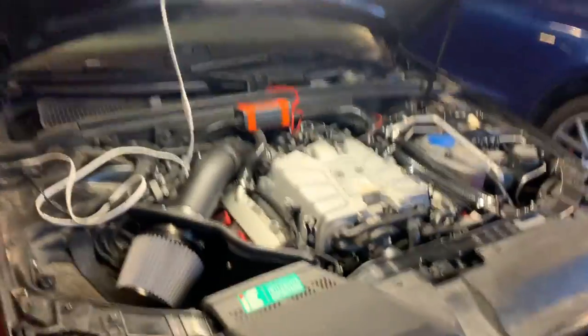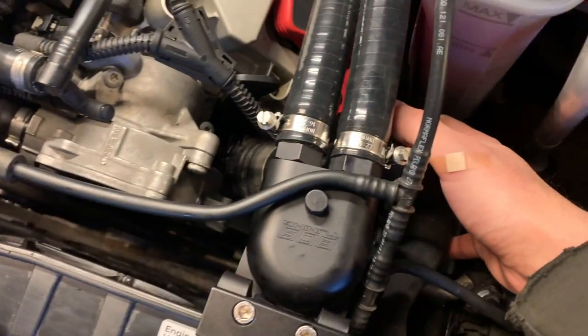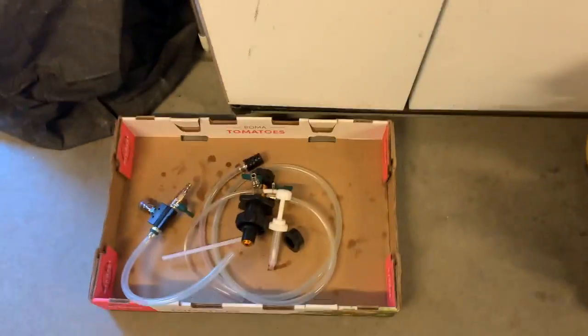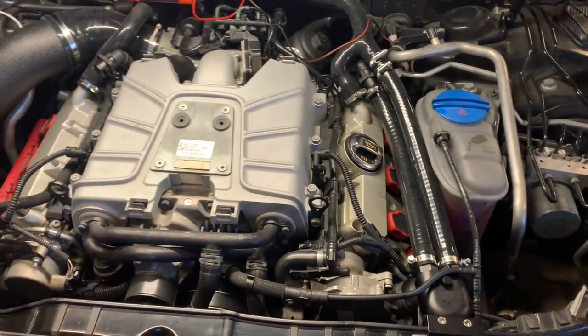Alright guys, so the update is I finally got a new O-ring for my upper rad hose when I changed the cross pipe. I did ask if I should replace the O-ring. He says it should be fine. Maybe when I put it on I rolled it, or maybe it was just too old. So got a new one. That explains why my Schwaben tool wasn't working yesterday. It was losing pressure. So finally replaced that O-ring and tested the Schwaben tool, and it actually worked really amazing.